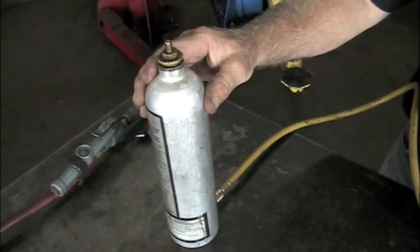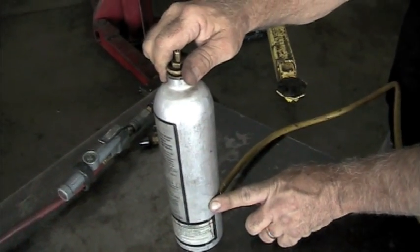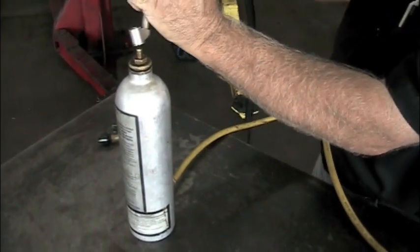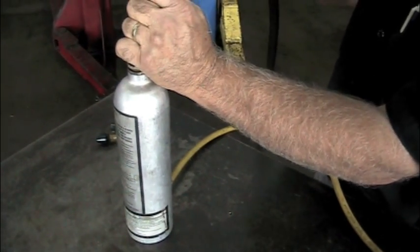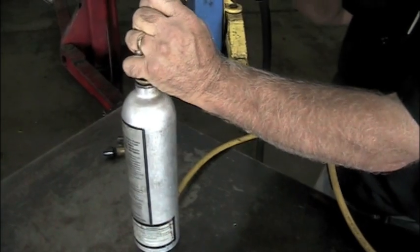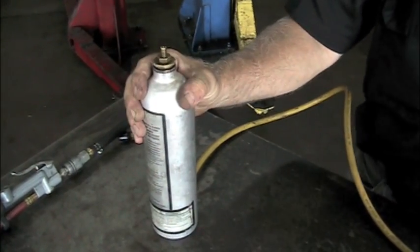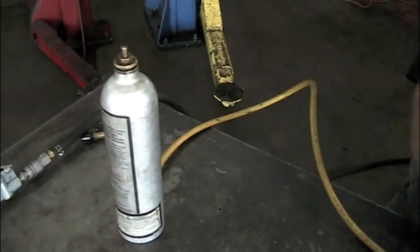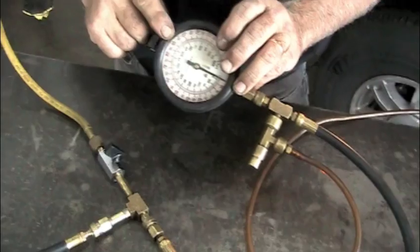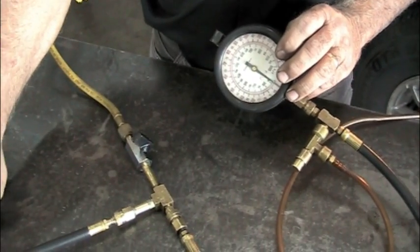This will become your fuel tank. You simply take this off and pour just a couple of inches of gasoline in there, and this is your fuel pump. You hook that on there and fill it up with pressure. So now you've got a fuel tank providing pressure that's going to go through here. You'll be able to read the gauge, see what your pressure is. You can control the flow and you're going to go right to the fuel port.